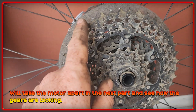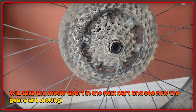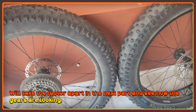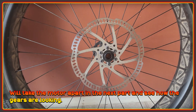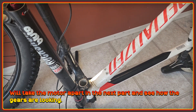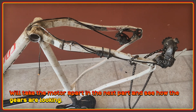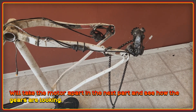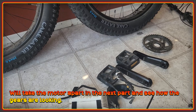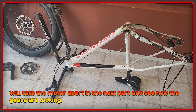Looking at the back wheel, I can see sharking on the big gear, so it's time to change that out and service the free hub or freewheel. The tires worked out great — really well. I'm going to put a better front brake disc on, going with the Magura floating point and upgrading the front brake size. I want to try painting the frame since I never liked the white. I'll get everything stripped down and rebuild this bike with the high voltage upgrade kit.